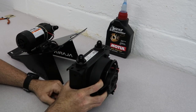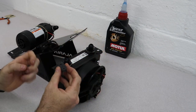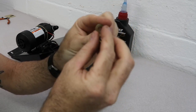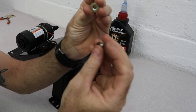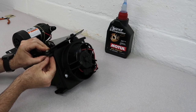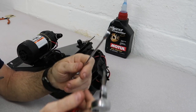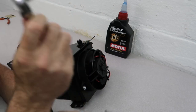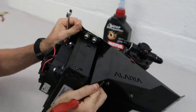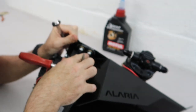Next we're going to mount the cooler and fan pack to the shroud. Go back to our hardware assortment. These little rubber isolators are going to go here. Need the little stainless quarter-20 button head bolts, larger washers, and again washer on both sides — under the head of the bolt and washer on the nut side. This quarter-20 hardware combination is going to be a 7/16ths wrench and a 5/32nds Allen. Again, because we're bolting down rubber, we don't need to super torque these things down. Basically tighten them so that the threads of the bolt just get into the nylon plastic locking part of the nylock nut. And here's the main assembly — the shroud with the cooler and the pump mounted to it.